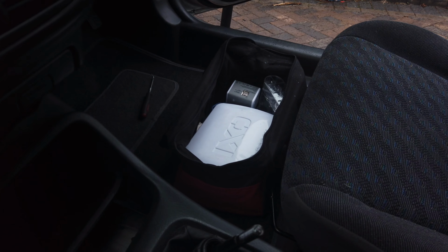Well, I believe what I'm going to do is go grab some Loctite. Yeah. Just in case they ever do come loose, you never know. Especially if you're on the motorway. Two pairs of hands, just because it's coming. Yeah. Right, underneath the car, you've got to go and get the two bushes for the gearbox linkage. So I'm going to try and jump down again now.